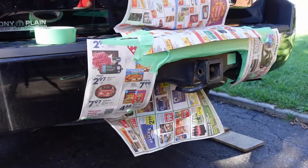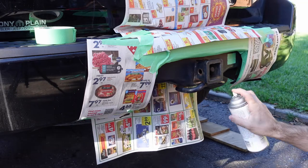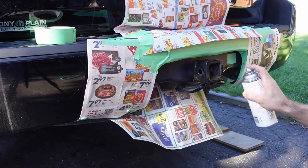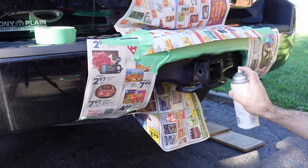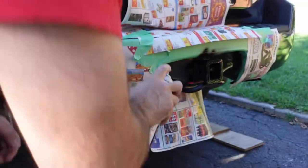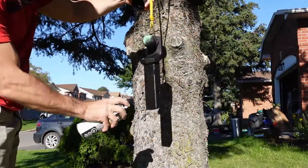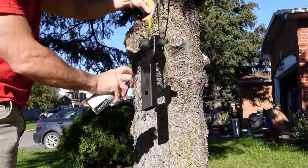For the receiver, I used a whole bunch of painter's tape to make sure I wasn't going to get any paint on the bumper of the vehicle, then added about a foot and a half to either side and a little bit in front of the spare tire as well. Not too much to this other than doing it in slow bursts and keeping the paint moving so I don't get any runs. I end up doing two coats with the matte — this is the second coat on the ball mount — and I went about 40 minutes between coats.